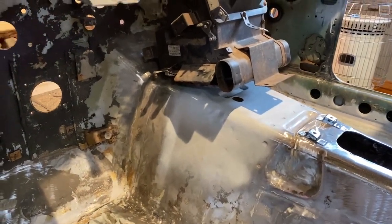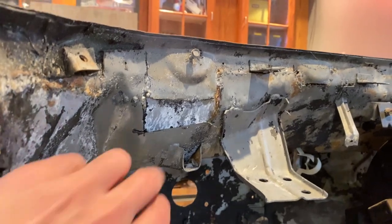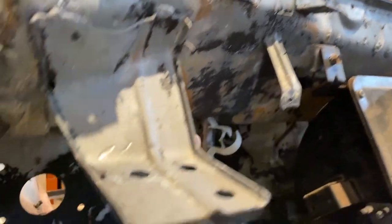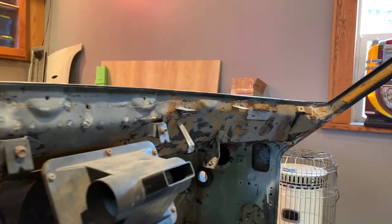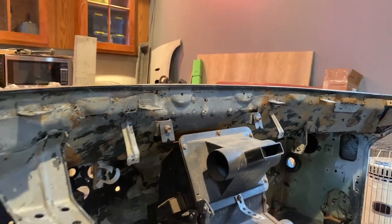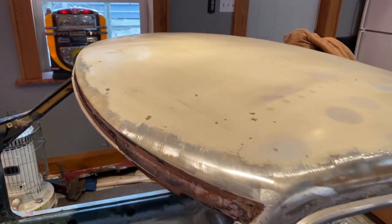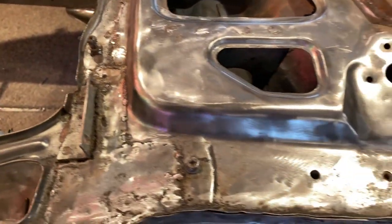Here's something really annoying. It must have been rotted out and they just seamed something right over the top — here's the old metal and they put the new over it, which is a pain to replace. They went all the way down there but didn't do it right. I think this was off a 280Z — he told me they replaced the drip pan for the windshield wiper reservoir and didn't do a good job whatsoever. You can see they monkeyed it up terribly — even after me trying to grind it down the welds are awful.